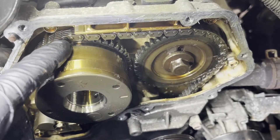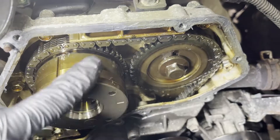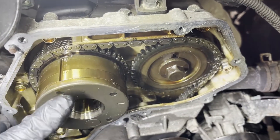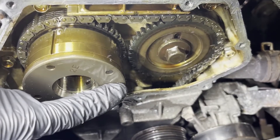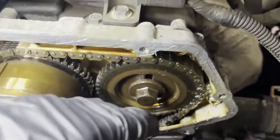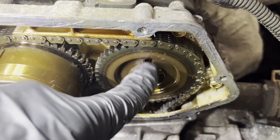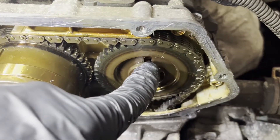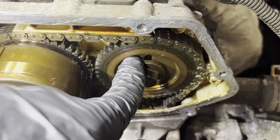The marks you want to look for — there's a hash mark right here. Be careful about the horizontal surface versus the vertical going straight up and down, because this mark here is not the mark you need. You need this one that's on this surface. Pay attention to the little keyway — there's a little nipple on the cam that fits in this slot.